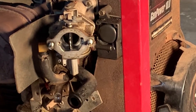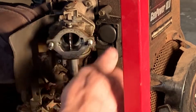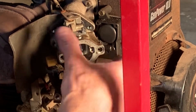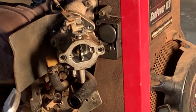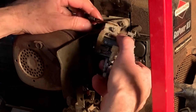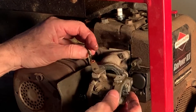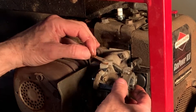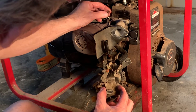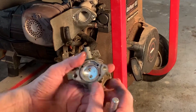We're going to go ahead and take the carburetor off. We're going to take these two bolts out and then pull the carburetor off. I'm going to take this hose off, then get this spring off of here — just go ahead and tilt it. It comes off. That's the main latch, and there's a spring that hooks in. The main wire was in the big hole and the spring was in the small hole. So we'll just leave those sit there and clean it all up.